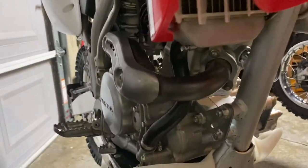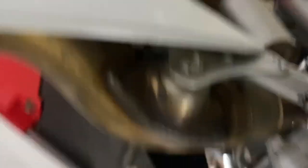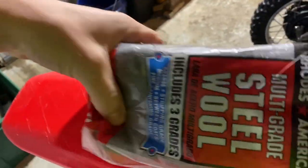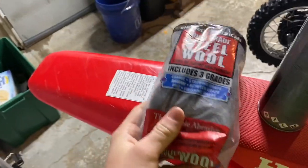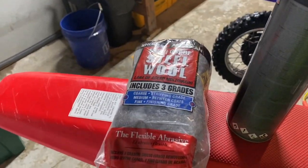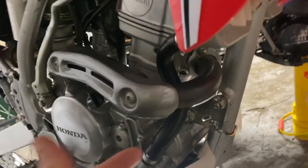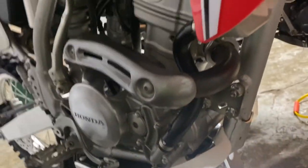Notice how nice my pipe looks — it even shines a little, and there's little to no rust on it, and it's like that the whole way, even on the muffler. What I use for that — if there's a little bit of rust after washing, which in most cases there is — I use some good old steel wool. It works great. I would recommend wearing gloves with it because sometimes you get poked. You can sand it if it's really terrible, but usually the steel wool works just fine. Then, just to prevent rust, put some WD-40 on there. It really makes a difference.